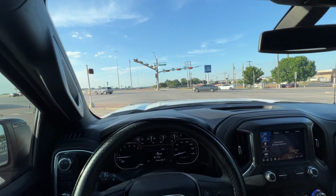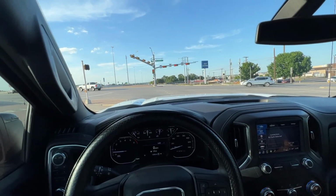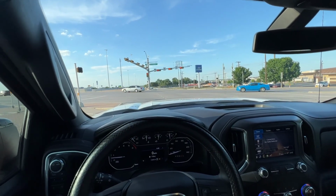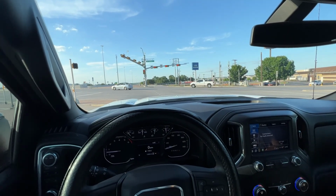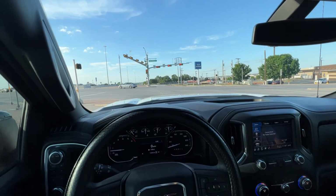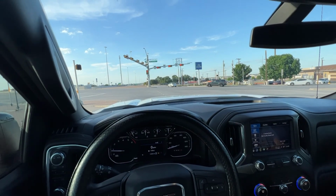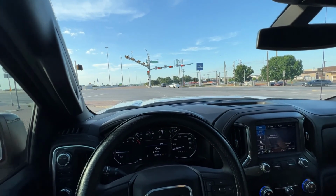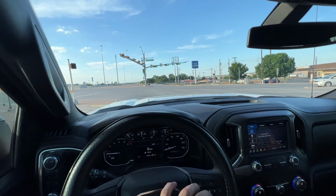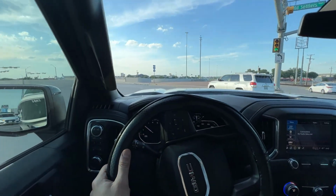Would I recommend them? If you're towing heavy stuff around and you just need a little bit of extra support, yes, definitely, I do recommend them. If you're just towing around something that's probably 5,000, 6,000 pounds, maybe a 22, 23, 24 foot boat with maybe a 600, 700 pound tongue weight at most, you're probably fine on the stock springs, and just get a drop hitch with the right amount of rise or drop and call it good. For me, at the top end of the scale, as far as how heavy you should be towing with a 1500, it's definitely helpful. So if you're trying to get that last little bit out of your stock suspension without airbags or anything else, these Timbrens are definitely an easy installation. 10 minutes tops for both sides combined, and fairly minimal cost and complication.